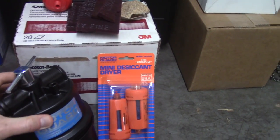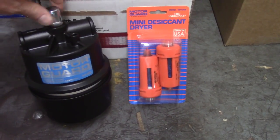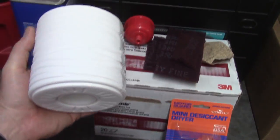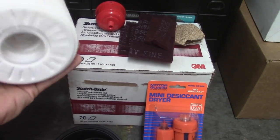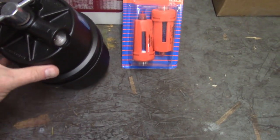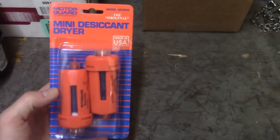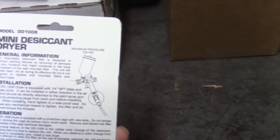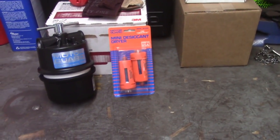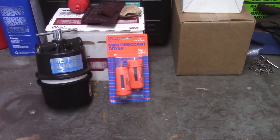It's a pretty cool design — somebody thought a roll of toilet paper would work for this, and that's really all this thing kind of is. It's pretty stout and heavy. It was about 60 bucks — a little pricey, but it has this filter element in here that really does just seem like a roll of toilet paper. I've read a lot of guys saying just buy cheap toilet paper to replace these filters since it's more of a moisture-absorption thing. I'm also going with an at-the-gun solution: desiccant air dryers, which got pretty good reviews. Looking at both of these together, you're looking at about 70 to 75 bucks total.